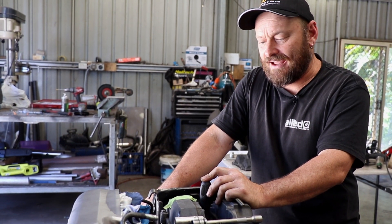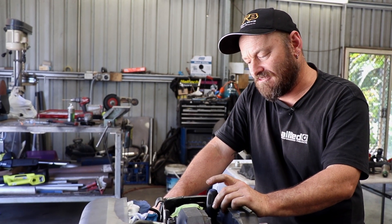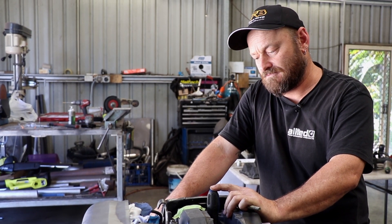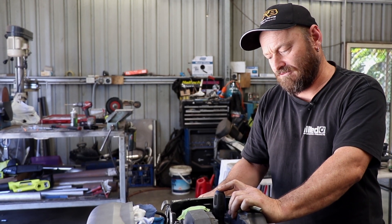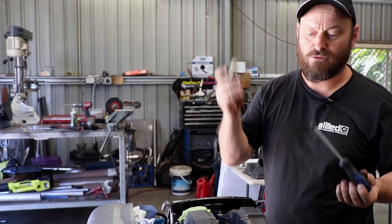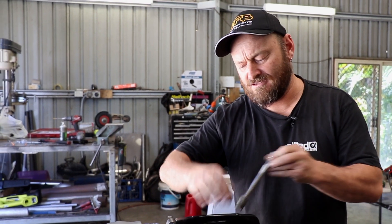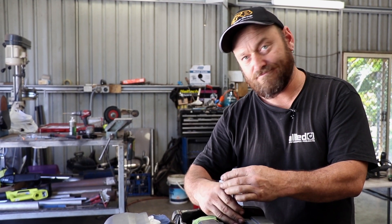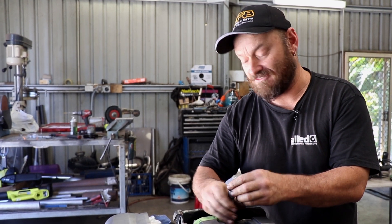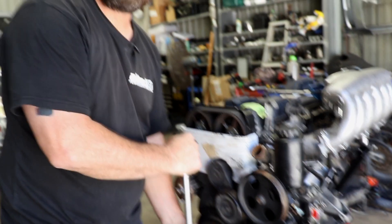If you've got an engine like this it's really easy to get at the spark plug holes — so it's not a Subaru. Your best bet is to just put the screwdriver or whatever in the hole and pull it down from top dead centre a little bit, then wind your bolt in. So you've sort of predetermined your first mark — it doesn't matter how far down it is or which mark you use, you're purely just bisecting the two marks and the centre point is top dead centre. You can hear the magical thunk noise — it means don't turn it any harder.